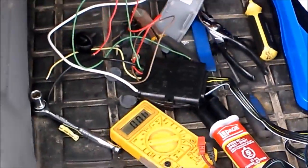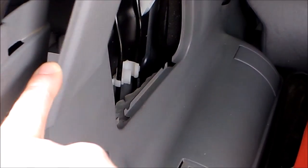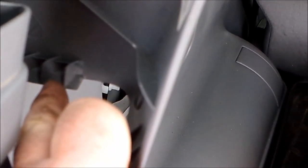I've got everything apart right now — I did this in order but I'm not putting everything back together to start again. You'll pull the side panel away. I disconnected it from the D-pillar — the plastic just slid the little tabs, you can see a tab there and a tab there — slid those up and out so I can slide this away. Inside you'll find the factory trailer wiring connector. After you've plugged in that F18 fuse, use your multimeter and test for power.